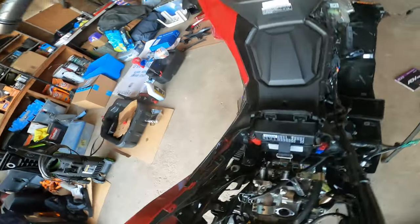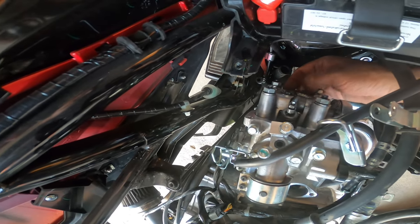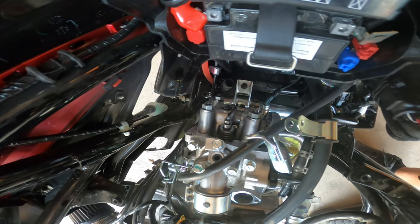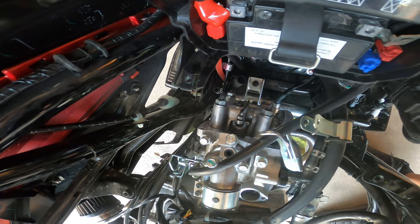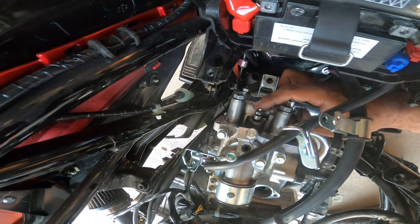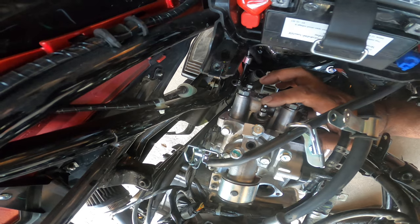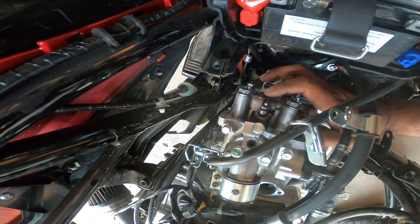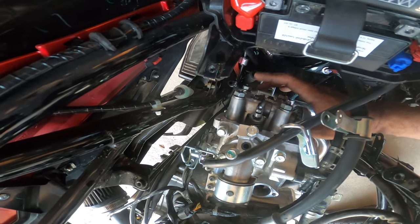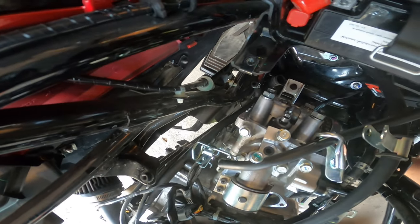That will set the exhaust and intake valve at the right amount of play that you need to do it correctly to get your valve set. So this is your intake valve, this is your exhaust valve. Intake valve is set at 0.010. Exhaust valve is at 0.024. All right, for your feeler gauge here, somewhere around here.